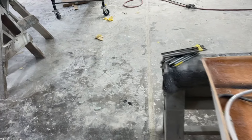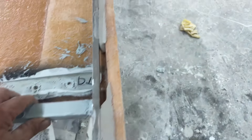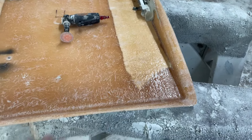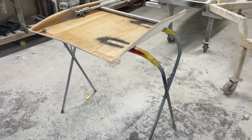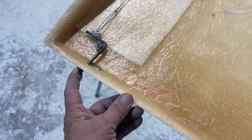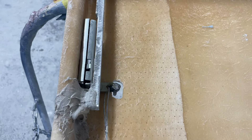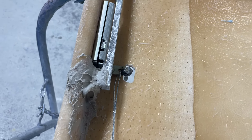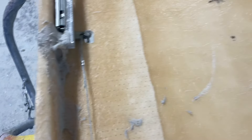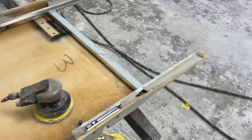After we get the power windows in — we've got them in various stages — this one I'm still doing a little bondo on. I put some aluminum in there and I've taken all of my doors. So this door is going to have a regular outside door handle. This one here has got our super secret spirit door handle — you can see it's going to come out the bottom of the door, so you reach under the door and just pull it. You can see it pulls the latch down. You've got to make sure you put the latches so that they go down for them to work.